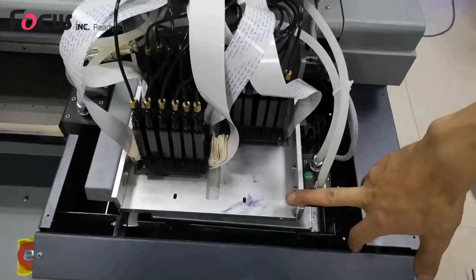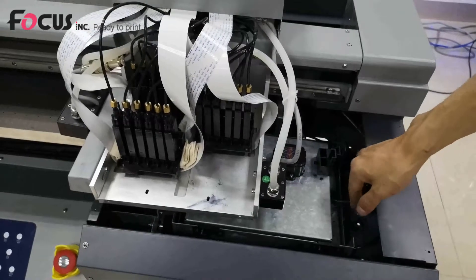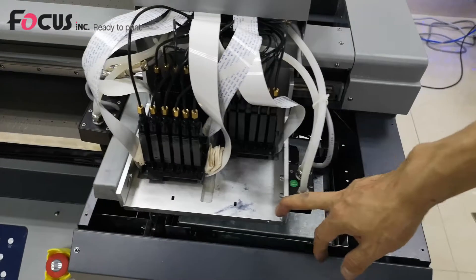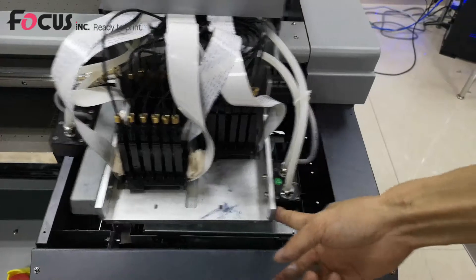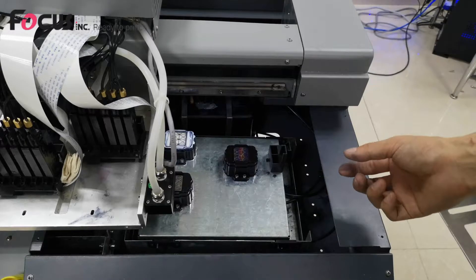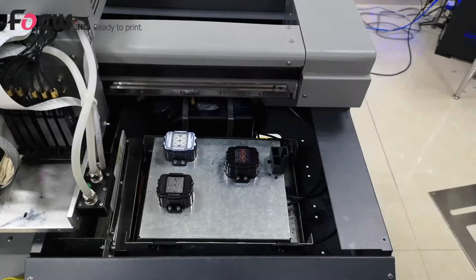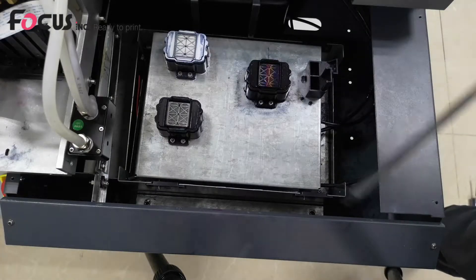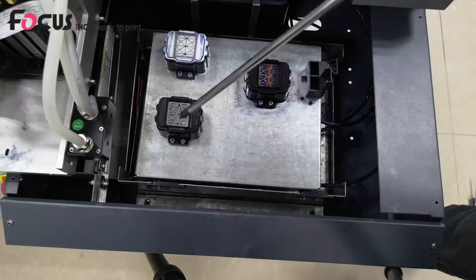This is the method to load the ink. If sometimes you cannot pull the ink out and the injection stays empty, just pull without any pressure — that means the print head and cap station are not connected properly. So we need to adjust the cap station with the print head. We go to the print head surface to check the connection.